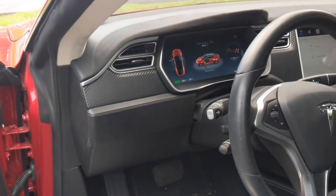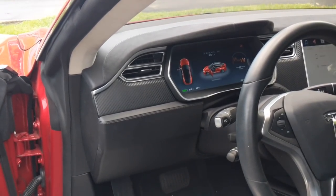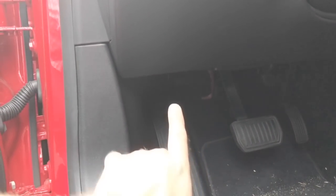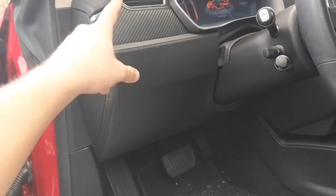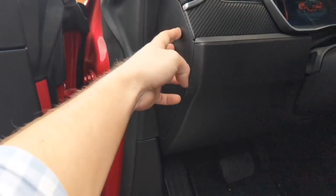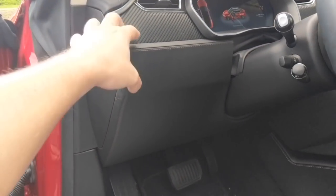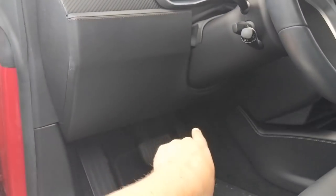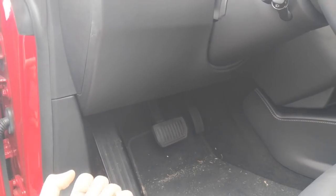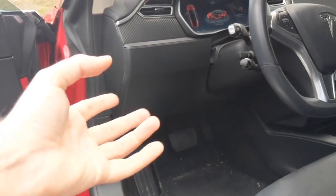For these parts I did not wrap them on the car — I took these off. There is one Torx underneath here. Once you get that off, take this side piece off — it pries right off. I believe there's a bolt on the side there. This whole piece that goes around the steering column all pries off from the bottom — pop, pop, pop, pop — a bunch of clips come off and the whole bottom piece comes off all in one.